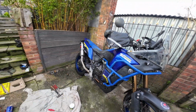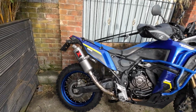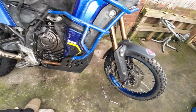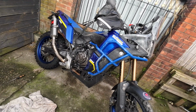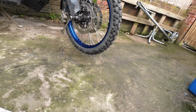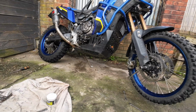Let's get the bike anchored back. Oh, you can see there now, the bike is up on the wheel. So strap down the handlebar. So you want to go right across the kickstand, that kind of angle, and obviously keep the bike on an angle to what you're anchoring it to. So you can see, front wheel's up off the wall, bike's over on its stand.